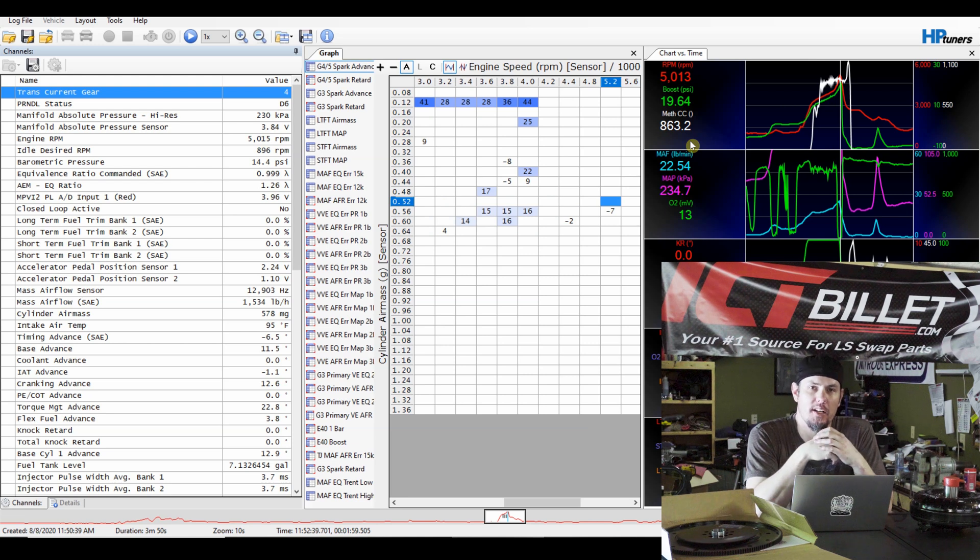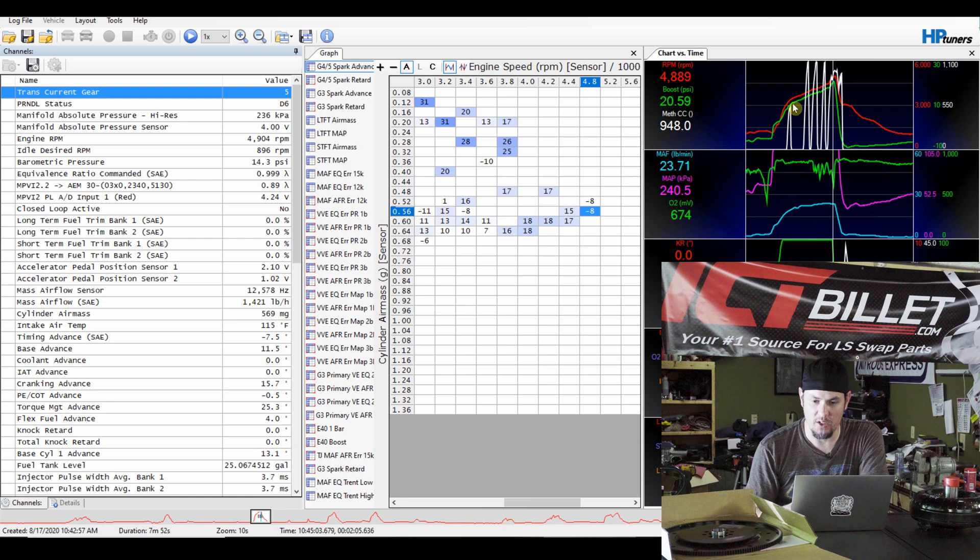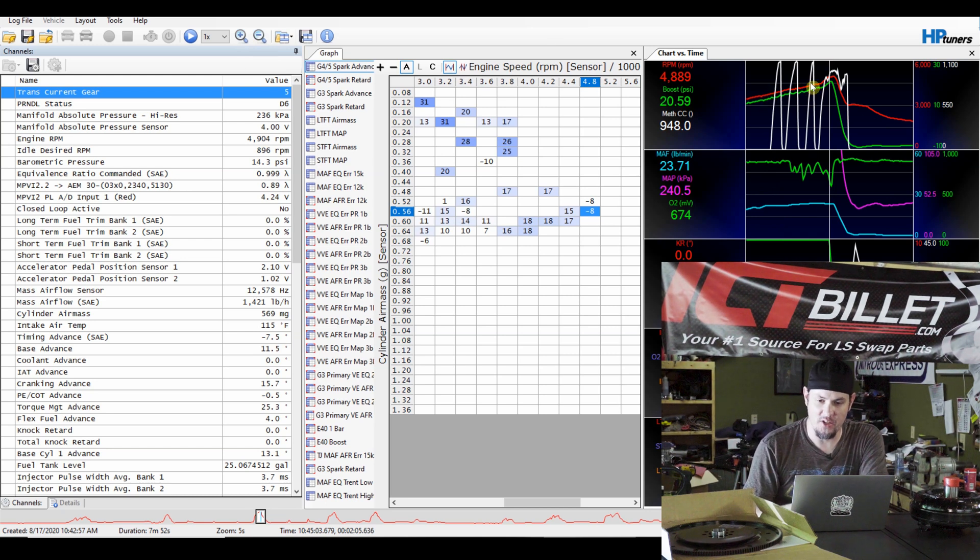We will have to see what this new pulley does — I'll do a review on that in a later, future video. But for now, belt slip is a big problem we all deal with on centrifugal superchargers whenever we start making serious amounts of power. I'm anxious to get out, get some miles, get this belt stretched, and see how the boost curve looks. We'll be picking up a little bit of boost — only going from the 3.4 down to the 3.2. The question is whether we see any fall-off towards the end. Look at the green line versus the red line: that is our boost building with RPM in a nice steady linear fashion — that's what we're looking for. Thanks for stopping by the garage, and remember: ABT — always be tuning.